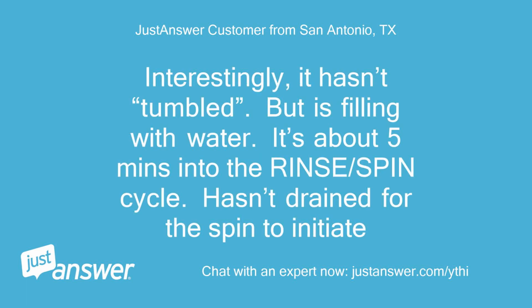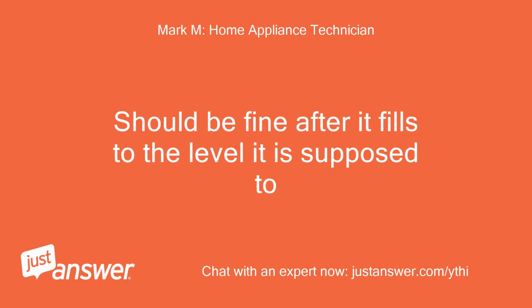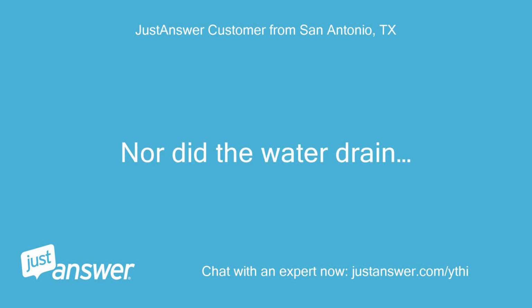Interestingly, it hasn't tumbled, but is filling with water. It's about 5 minutes into the rinse/spin cycle. Hasn't drained for the spin to initiate. It is going to fill up all the way since it is also a rinse cycle. Should be fine after it fills to the level it is supposed to. It didn't spin. The console went back to the original time for the rinse/spin cycle, 12 minutes, and the start/pause button is blinking. Nor did the water drain.